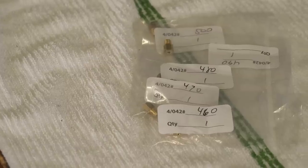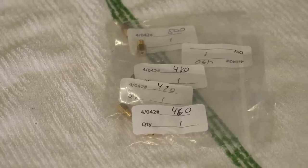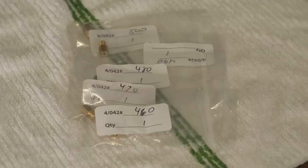To fix that lean condition, go up a jet size and run the bike again. Repeat until you find the right size. These numbers on the sides of the jets might not increase or decrease in increments of one — usually it's a number like five or ten. When your bike's rich, it means there's more than the optimal amount of fuel in the air charge, leading to stumbling and poor overall running. It doesn't lead to a premature death like a lean condition can, so if you have to, err on the side of being rich. If the bike moves through the mid-range and onto the top end, the power is going to stumble and miss. It's an easier condition to feel and hear for most people, and it's very clear the bike is running bad. Just drop a jet size and retest it.